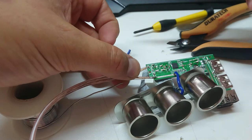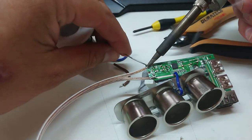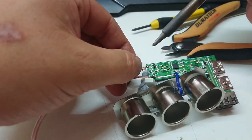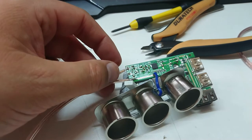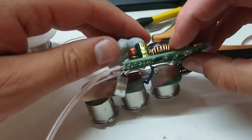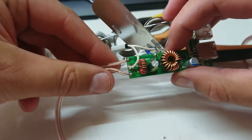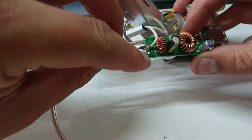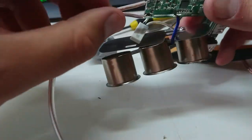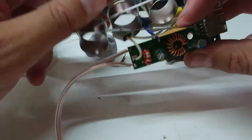We're going to go in like that, and we might actually put a bit more solder in here just to help give that a better bond. I'm hoping that the solder going through the hole should create an anchor, just because that hole is not big enough to fit these conductors through. Now we can see there is actually already plus and minus — positive and negative — marked on the board. The trace wire is into the one marked positive, so I'm pretty confident we're good there.